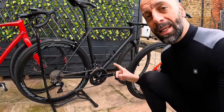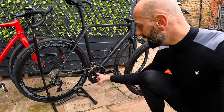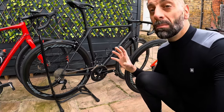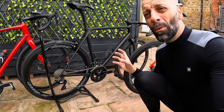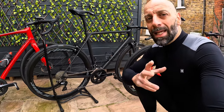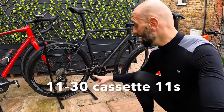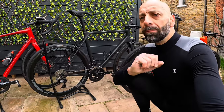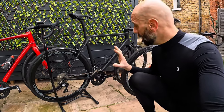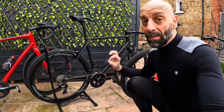The semi-compact, however, is maybe the perfect combination because you have a 52 here and a 36 as the inner chain ring, allowing the best of both worlds. The 52 with the 11 gets a very good speed on the flat — quite unlikely that you will overspin the highest possible gear, but you will be at a reasonable speed anyway. At the back, this bike has an 11-30 cassette, so your lowest gear can be a 36/30 that, if you are fit enough, will allow even the steepest gradient, especially on a light bike like this. So this combination is maybe the very best I would recommend — this gearing is ideal for most situations.